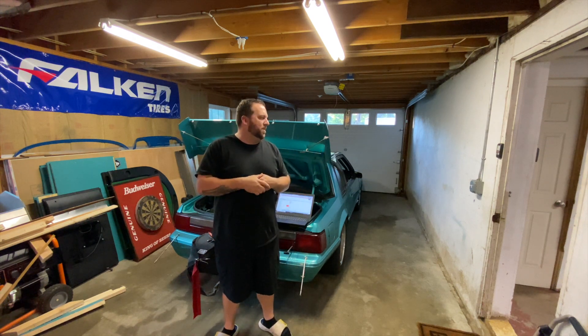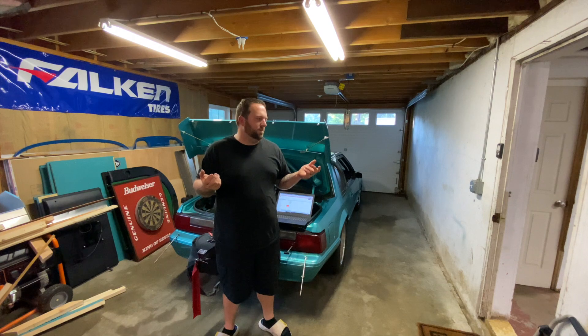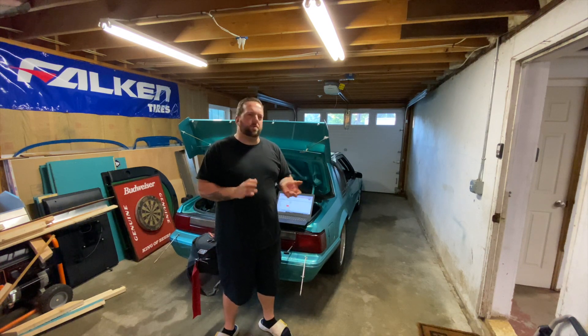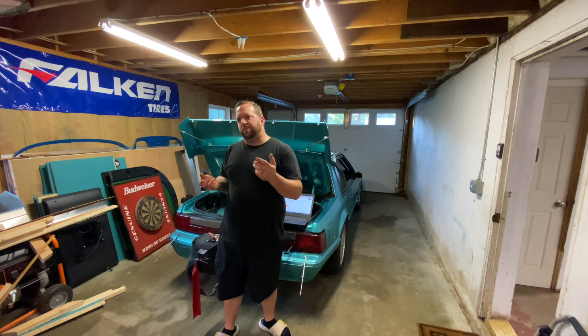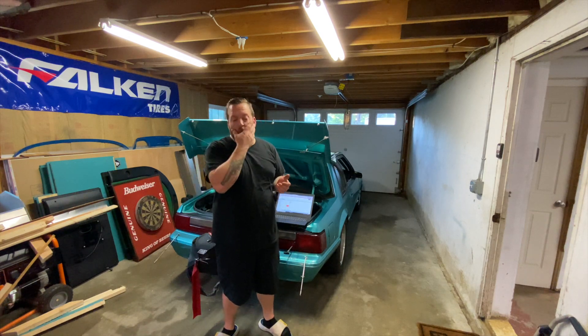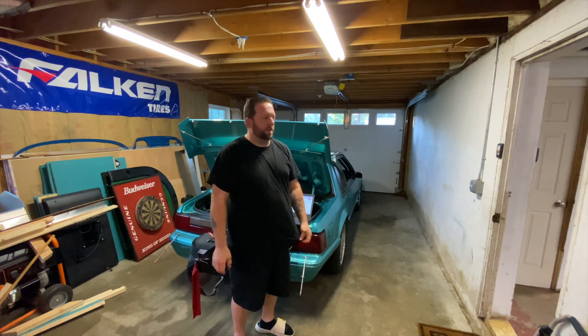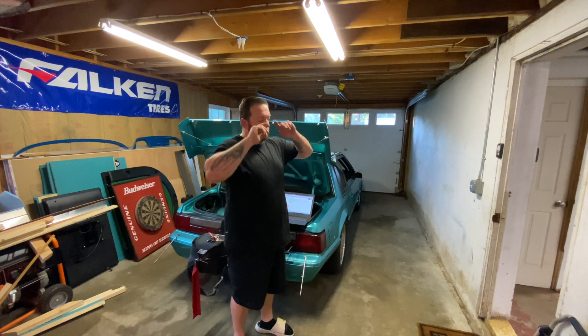Welcome back everybody. The car made great power on the dyno — 905 horsepower, not fully maxed out. We don't quite know where this turbo will end up. We're thinking more in the 29-30 pound range, so we could get four or five more pounds out of it, hopefully putting us in the 1050-1080 horsepower range fully maxed out. We were having problems with the dyno reading 3200 foot-pounds of torque and calling it a pro mod, so we know that's not right.